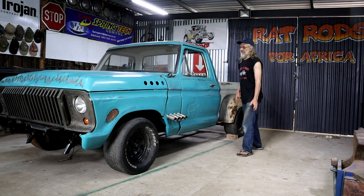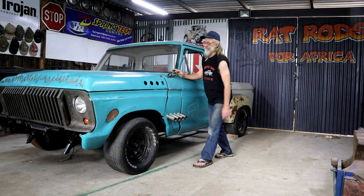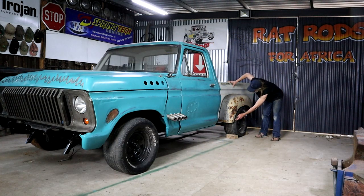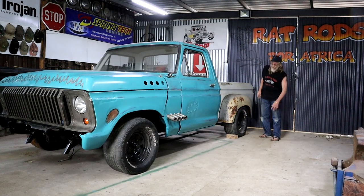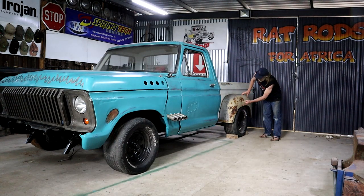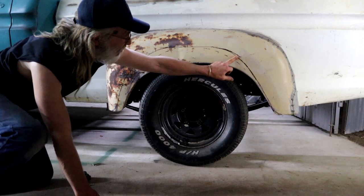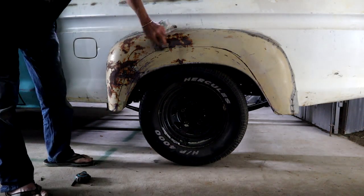What I'd like to do now is look at this opening here and maybe put the same opening in the back. Because I am chasing my final cutout on this fender, and when that's done I can paint this. So I'm gonna measure that opening and put it in here to see what it looks like. If I make this wheel arch opening the same as the front — that's the line I'm getting — but that's not working for me at all, I really don't like it. I don't think it's gonna look right, so I think I'm gonna mark another line.